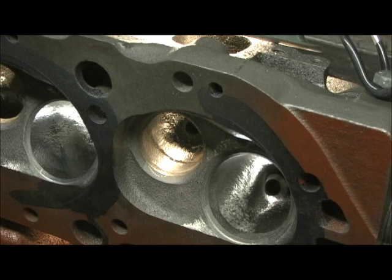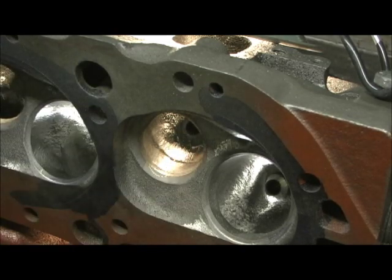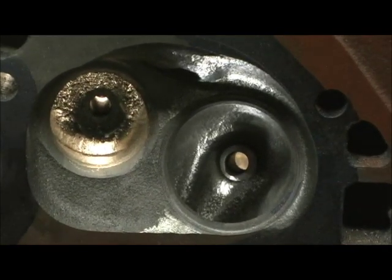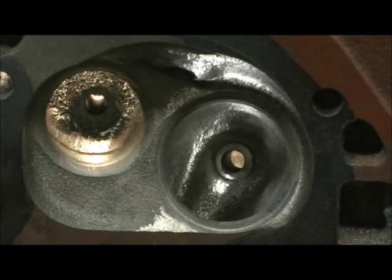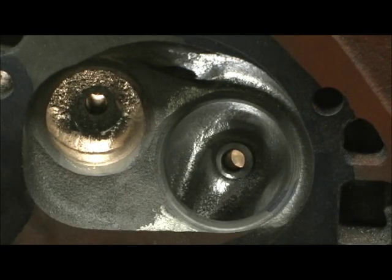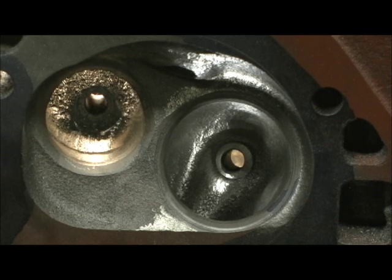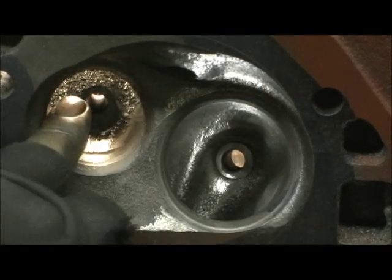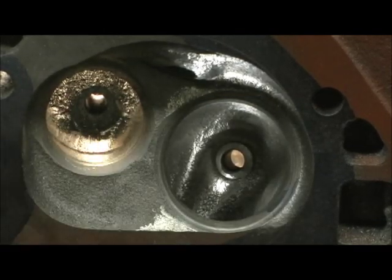A lot of you probably already know that. But those of you that have never taken one of these ovals to a humongous bowl like what these are going to have for the valves, it's a lot of heavy metal removal. Look at the amount of bowl — it's just a chunk of metal. I'd say probably right there in the bowls around 12 cc's in this raw cut form, and that's before the valve job on the intake. The exhaust ain't nothing to laugh about either — quite a bit comes out of it.